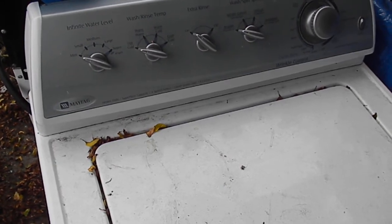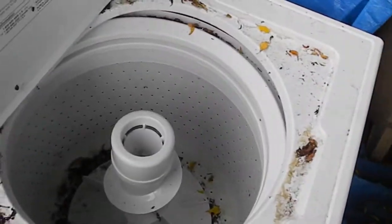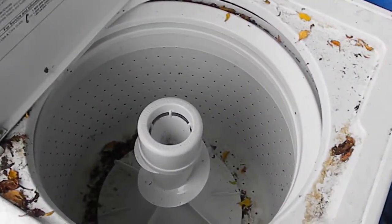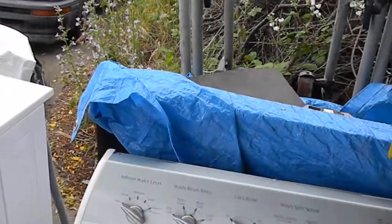Later my neighbor called me and said it's not working again, it's not spinning out. So I looked down there — what these things do is they'll burn the pulley on the motor. It's a sort of a nylon pulley on the motor. If you see that, you likely got a bad transmission. These things are really big and I've never seen any problem with the agitators — huge tub. But I think people tend to overload the thing, and when they overload it, it's going to put strain on the transmission.